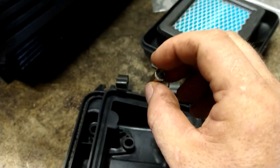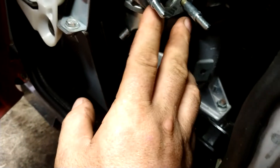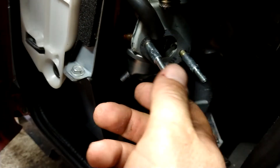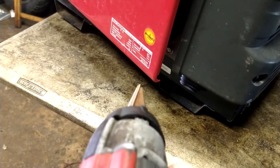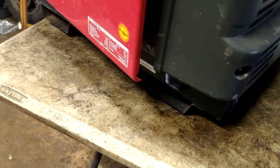You're going to take these sleeves out. Now there are two extensions that are in the kit that you screw onto the studs. Get it down as close as you can and then tighten them all the way with vice grips. Then you have to drill a hole in the bottom — there's a plastic clip that goes inside of it. Use this drill bit and get it almost that size, but then once you get it in there you've got to waller it out slowly so you can get that clip to fit in.